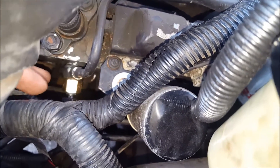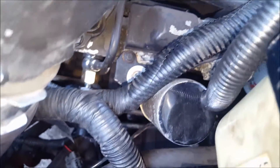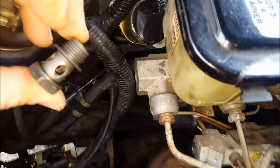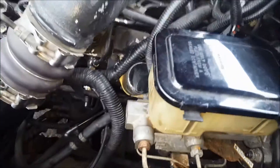What I recommend is the Torque Tech snubber adapter. It's basically a banjo bolt that's already been drilled out and has a snubber built in, which is nice. But if you don't have the money for that and you want to check it, you're going to remove this here banjo bolt — it's a 19mm head on that. When you remove it, make sure to clean around it real good first.